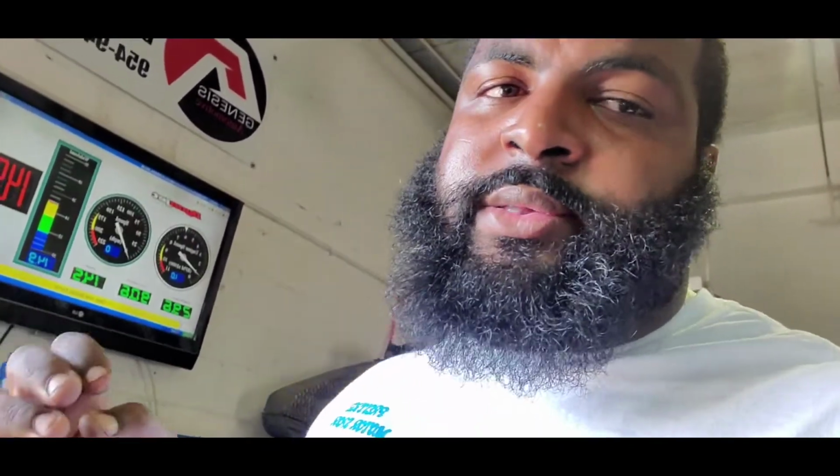All right, guys, I got the cruise all set up. I'm actually going to do the first pass real quick. And don't forget, guys, I got the cam angle preset at 10 degrees for non-VTEC and VTEC. So we're gonna see what the outcome could be. Hopefully. I think it's a little on the rich side, but we'll see how much it makes, and then we'll make a change from there.